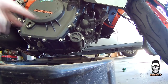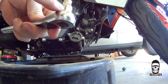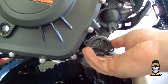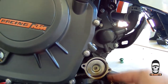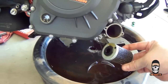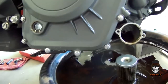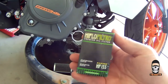Lastly, you'll need to remove the two 8 millimeter screws to get the oil filter cover off and swap out your old oil filter for the new one. Once both screws are removed, take off the oil filter cover. The fun part is removing the oil filter itself — be careful not to score or gouge the inside of the oil filter compartment as you pull the old one out, as any damage could lead to oil leaks later. This is the step where you want to exercise the most due diligence. Once removed, clear any excess oil from the reservoir by tipping the bike or using clean towels.